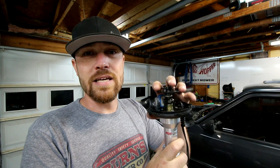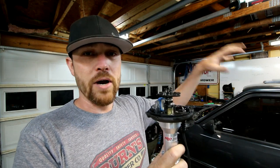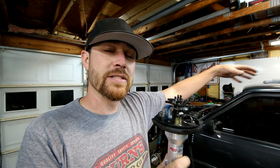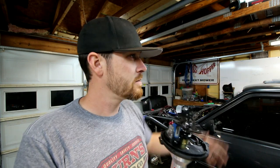That makes sense. I didn't need all that on this thing. This is just going to be a cam sync. All this thing is going to do is tell the brain where the beginning of the combustion cycle for all cylinders is. Does that make sense? All it does is tell the brain that number one is getting ready to fire. Then it knows that it can go through the complete firing order, and once it's done, this thing will trigger it again. That basically just lets it know where it's at in the cycle.